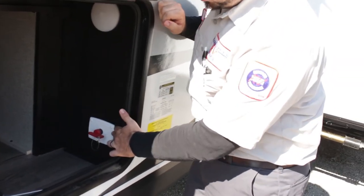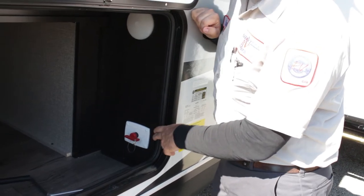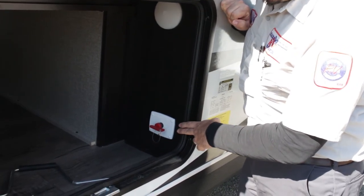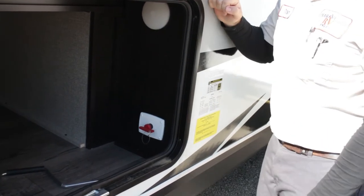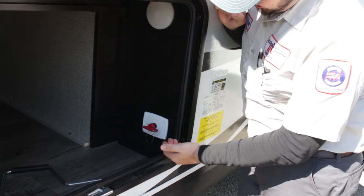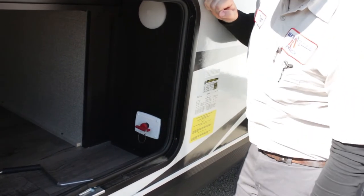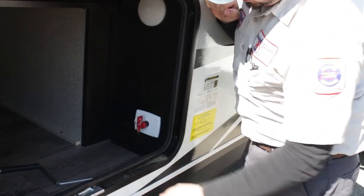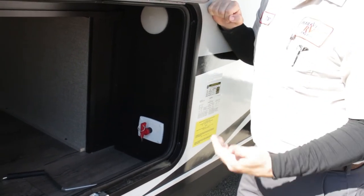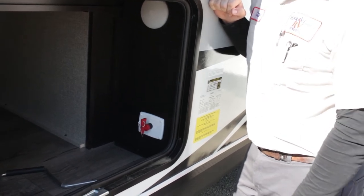On this particular unit it is equipped with a battery disconnect switch — not found on all trailers but mainly the Whitehawks have them, and some Jay Feathers as well. All it does is disconnect your battery from the system during storage. Whenever you are using it or traveling, make sure the switch is in the on position so the battery gets a charge. Whenever you're done camping, flip it to the off position so you'll have a full charge battery for your next trip.